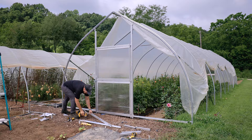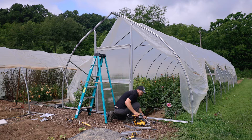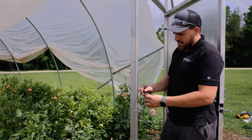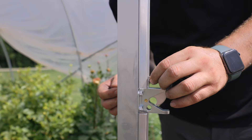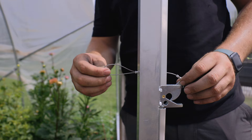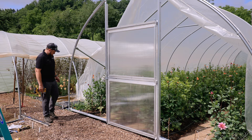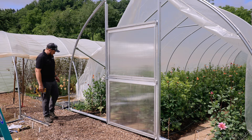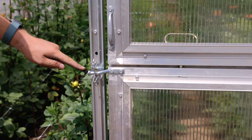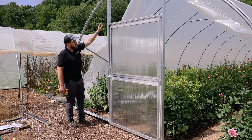Install the spring wire channel. Since installing it covered up the hole in the door post, go in from the back side with your drill bit and drill through the channel. Pinch the wire and feed it through — it'll come out the back side of the door post as the latch cable so you can open the door from the inside. The bottom base bar runs straight across and straight up to the latch; on the top side of the latch, pick it up again and go straight all the way up to the top.